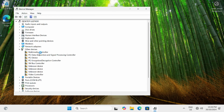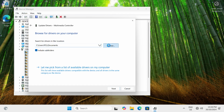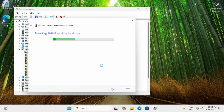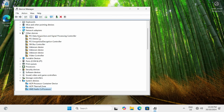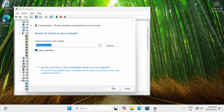I created a Windows 10/11 installation media with Rufus that lets you avoid having to use a Microsoft account, and you can also have a default username and so on. Windows installed just fine. Then in Device Manager, of course, we have a lot of unknown devices, and all you have to do is point the installation to the driver repository folder on your USB. It will find all the drivers.